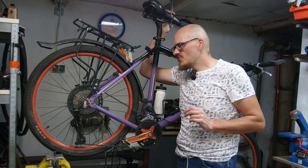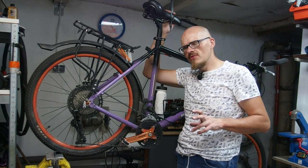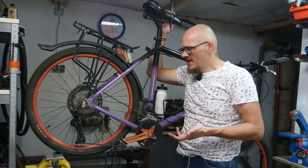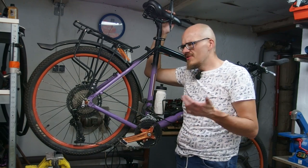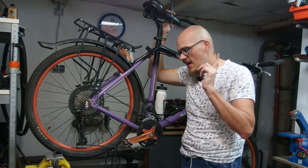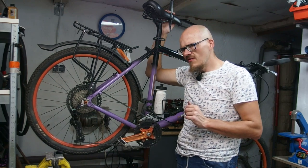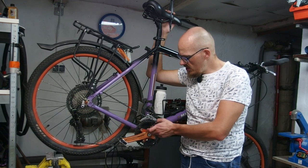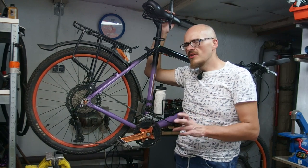However, what also struck me over this entire thing is that for this particular bike, at least, it's completely superfluous because I spent like all of my time on the big ring. I never used the small ring, even though I could, but there wasn't really a need for this because 44x50 on the terrain I was riding was plenty of low, to be honest. However, if you were keen on doing something like this, then it's quite possible, because I can see someone use a crankset with 10-tooth difference between the cogs, but 20-32 or something like that, to get some ridiculously low gears out of a setup like this.